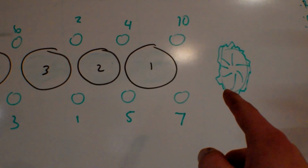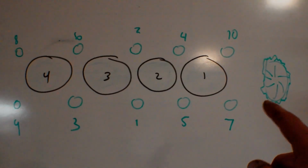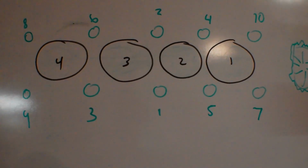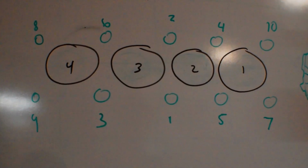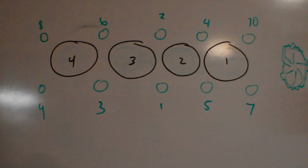There's the timing cam gear on that side, so that's how you know it's the front of the motor. So yeah, this is our torque sequence, and we're going to do it in 3 steps, 30, and then 60, and then 90, which is very tight. I'll be cranking on the torque wrench, but that is the torque sequence, and that's what ARP recommends.